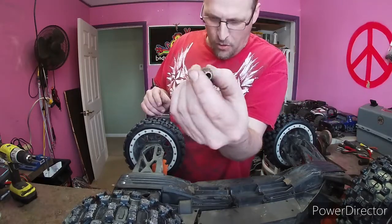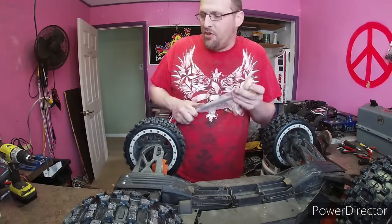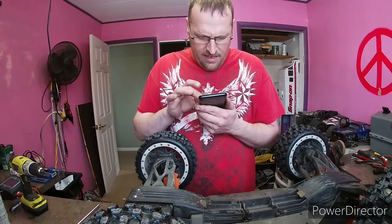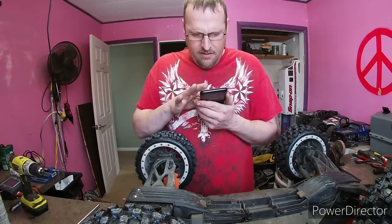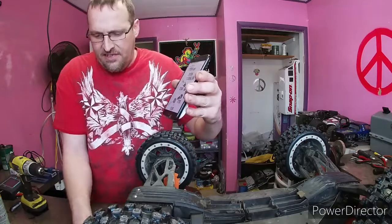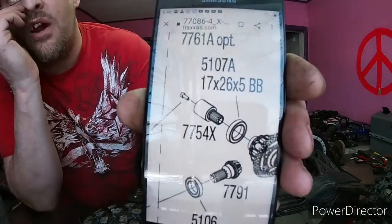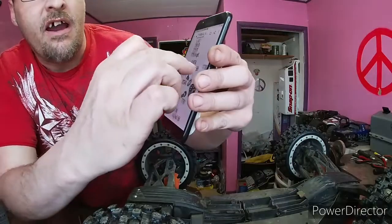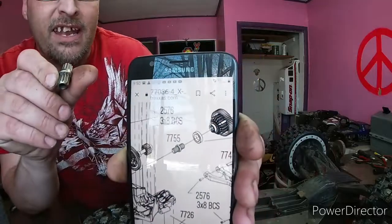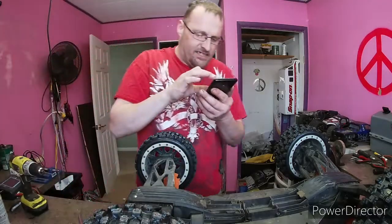There's supposed to be a bolt that holds that in to the rear end, I do believe. I'm going to put this new one in and just save the old one. It was fine. I had to go back and double check and look at everything here. I know that the drive cups, having this same spline and type of design of spline, have a screw. I hope you can see that. Now, if you go to the driveshaft, nowhere does it show a bolt going into it. So maybe I was wrong. And now that I look at it, yeah, it's not counterbored to hold a socket head cap screw. So yes, it does not take a screw there.